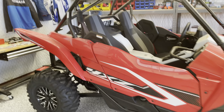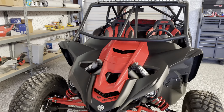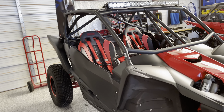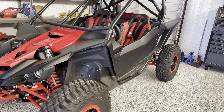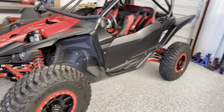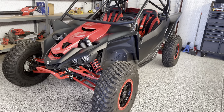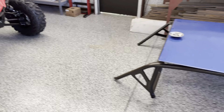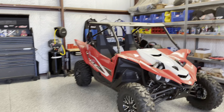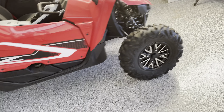So I'm gonna have a nice fresh set of 2020 red plastics sitting around in the shop that I'll be itching to put on something. I already asked Brooklyn if she wants to put the red plastics on her car so it would be all red — no flat black — but she doesn't want to do it and I'm not gonna put forth the effort if she doesn't. I love the red and black and think it looks cool. It would be pretty easy except for the front piece because you have to pull the cage — the front fenders are difficult because the cage is wired in. If anybody's ever done a cage swap on a Yamaha YXZ, you know it takes quite a bit of finessing: you've got to jack the car up in the right spot, use ratchet straps to pull the bars together, and sledgehammer everything down to get it to slip on.